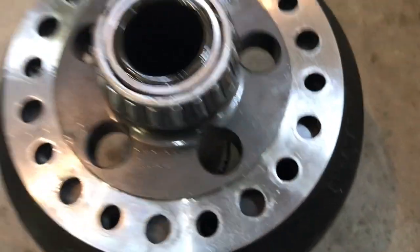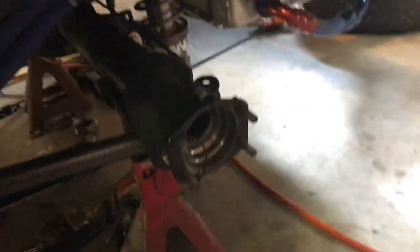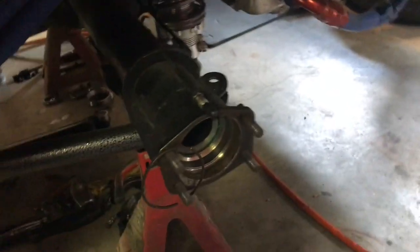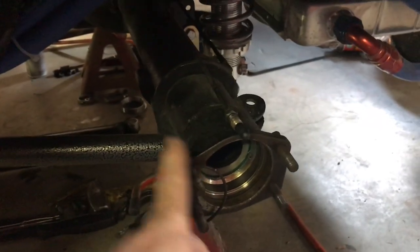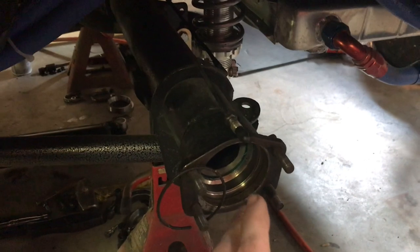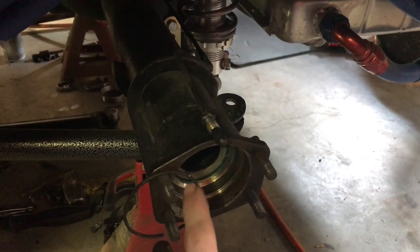My Strange spool is going in here. While we're at it, believe it or not this car still had crappy old drum brakes on the rear. I've got fancy Wilwoods up front but I had drums on the back — we're going to ditch those. I found that this end is an 8.8 fox body rear end, factory rear end, but it has these ends on it which are kind of like nine-inch ends almost.